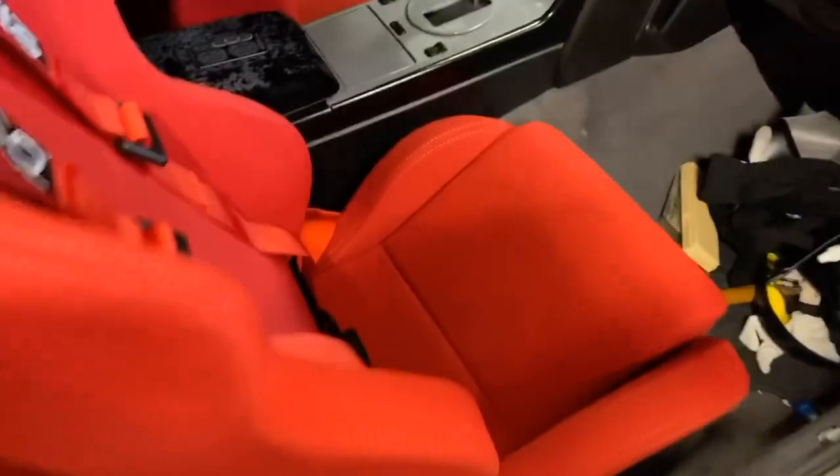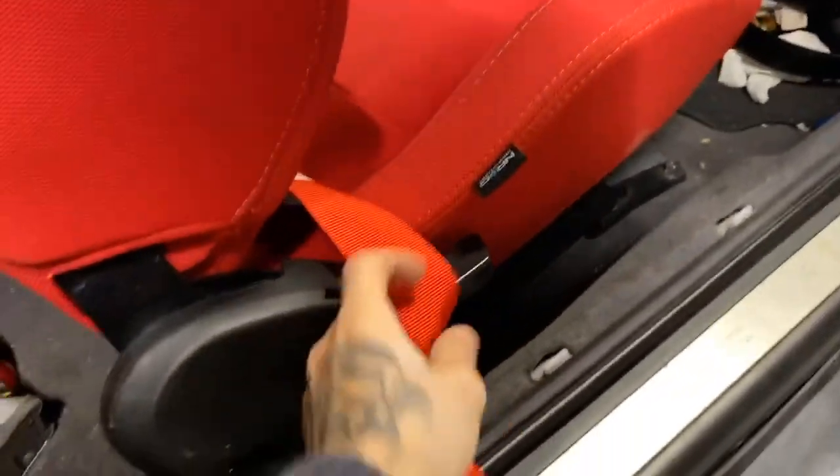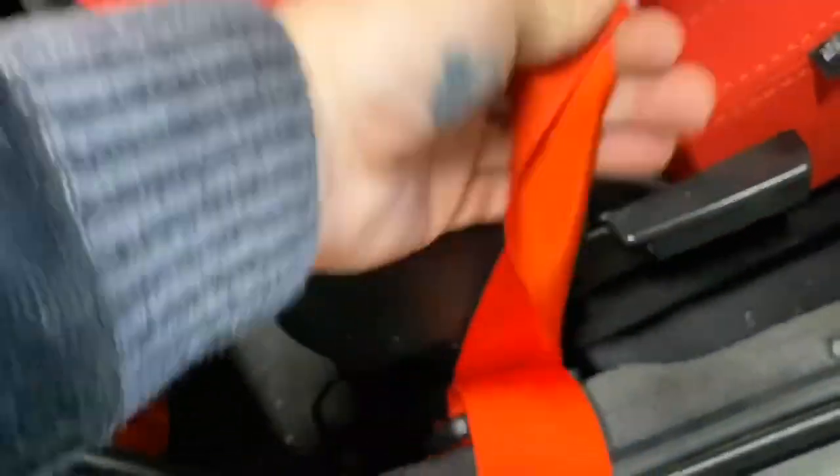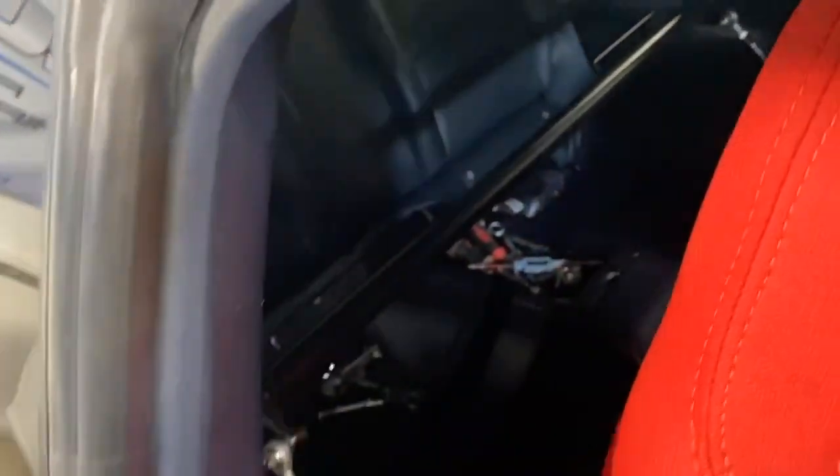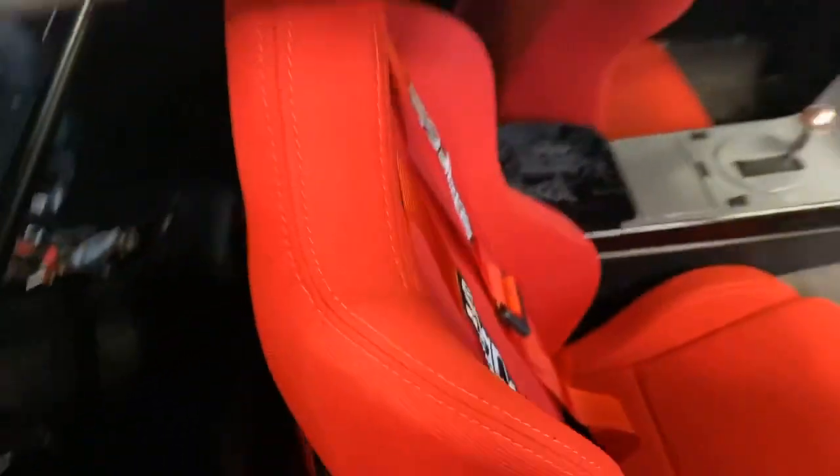Quick update — I came back out here again this morning. From my research and understanding, I actually put the little bolt on wrong. So the seatbelt attaches right here to this, and then the other side of the seatbelt attaches to where the plug was for the OEM seatbelt. We got those all plugged in. Now I pretty much just have to cut and then attach this to the actual harness bar itself, and for the most part we're pretty much done.